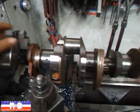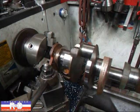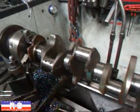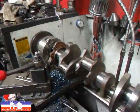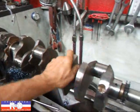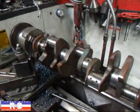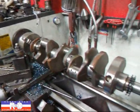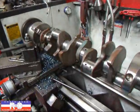We've actually got a bore and stroke and rod length combination that means we have to remove about 400 grams of weight off the counterweights on this crankshaft, because the connecting rods are extra long on the length. So we're having to do this modification so that we can actually get this thing to balance. We put it on the balancer and came up with about 400 grams out of balance, so by removing weight here it's going to make it much easier to make the corrections on the machine.